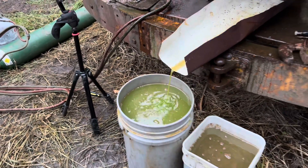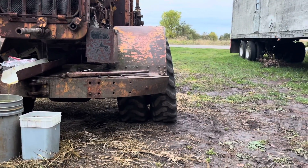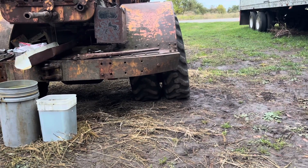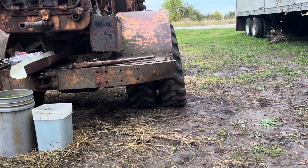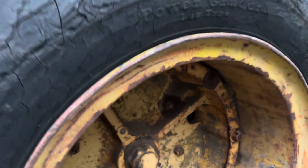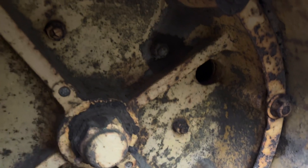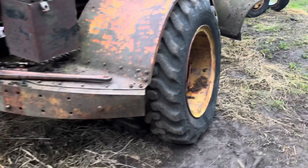I'll show you the issue I am concerned about — I think I mentioned it during the walk around. See how crooked that wheel is on the right side? The axle shaft comes out of the housing with a taper, and the hub presses onto the tapered axle shaft. It doesn't have a floating axle like a big truck; the hub actually bolts right onto the drive axle. That being at an angle is not a good sign. I don't think it's just wheel bearings — I'm afraid I'm going to find that the hub is flopping loose. It doesn't show wear here, but if the axle was actually broken off, I'd think the wheel would have come off the brake shoes. Whatever it is, I'm sure it's not going to be good — there's going to be some carnage in there.